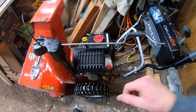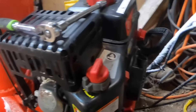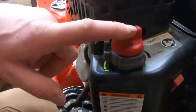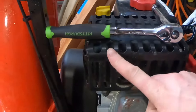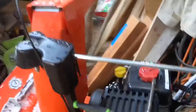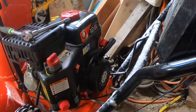Today we're going to pull all this stuff apart — like the last video, we'll go through step by step and clean that carburetor. The first thing I want to do is show you the bolts so you can see them up close. Right here next to your run and start, there's one here — pull this off. Come around just behind the chute, there's two right here — pull those off. After those are off the shroud will come off, and then there's one down here — pull that off. That's what I'm getting ready to do right now.